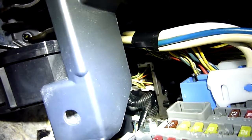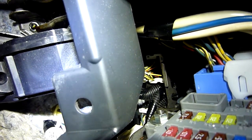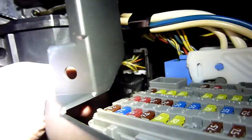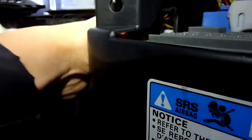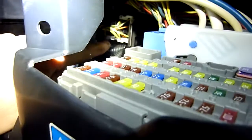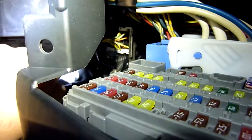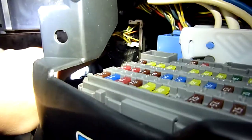See where there's a bunch of yellow cables — don't worry about the fuse box. There's a black cable that looks like it's got rings on it, and then there's loads of yellow cables coming out. I'm going to put my hand in and stop pressing the button. There's one, two, three relays. So let's count them: number one, number two, and the rear one is number three. I'm getting the most click from the second one. The third one's not really doing much.